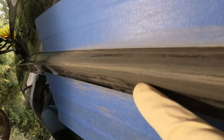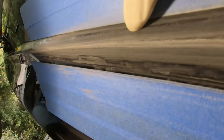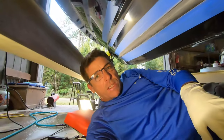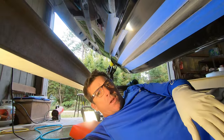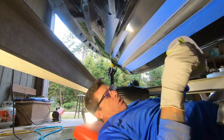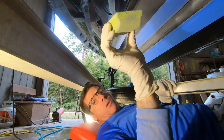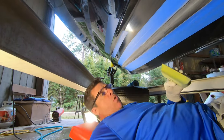That's how you should look with the 220. You can see there's still some little profiles there that we haven't sanded all the way down. There's no point in that, but we've gotten all the big, rough, jagged stuff all knocked down. Same goes for this upper one. And what you just do is you just work progressively. We're going to go from 220 to 400, is kind of the typical. Again, I'm using the little 3M foam block.